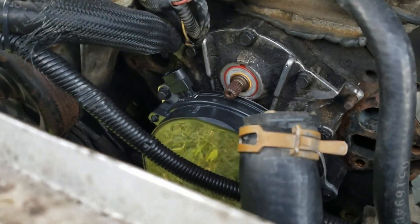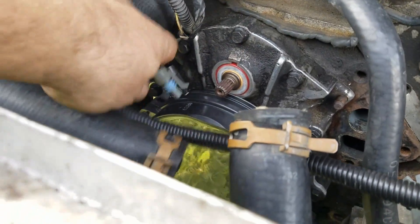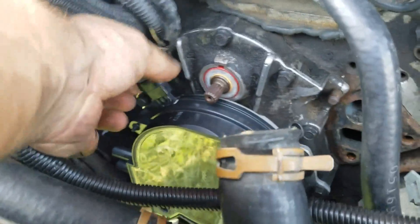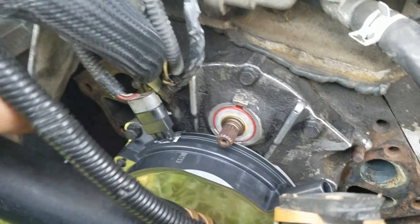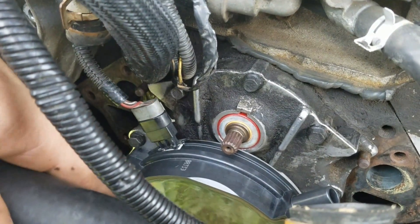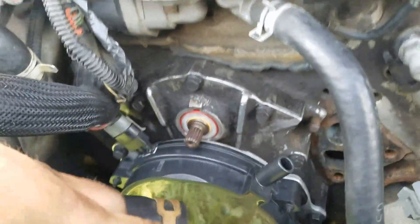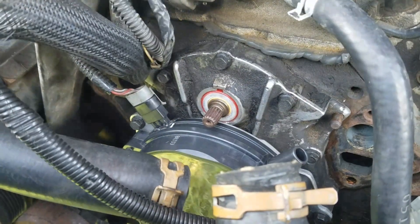The opti is torqued down, and you want to at least plug it in before you get the water pump on there, because it makes it a real pain with the water pump in the way. You can't really get your fingers down in there — you almost have to push it down with a screwdriver. So plug that connector in now. That's not a big deal with access here, but it is a nightmare with the water pump on.